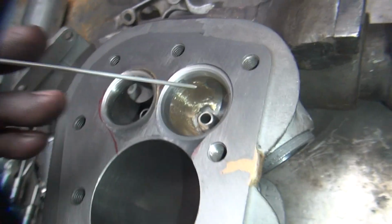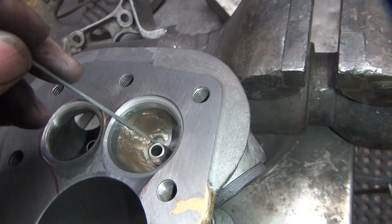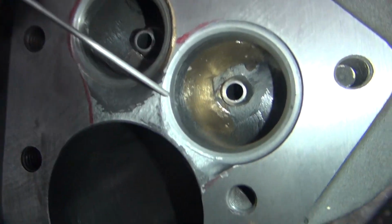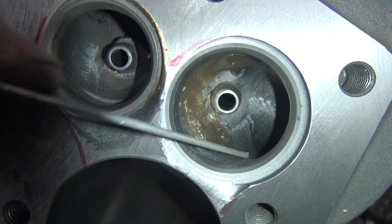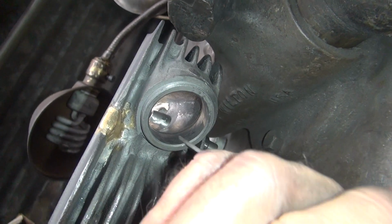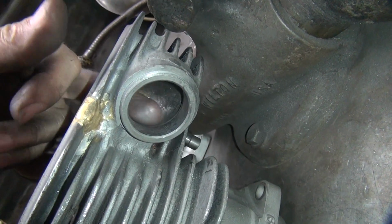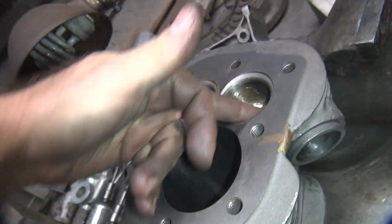The intake port, we did a lot of cutting on that. So the air can come straight through here real nice and easy. There's all this taper stuff in here. We did the brass. And I had to do a lot of cutting all through here. All this stuff here got cut away. There used to be a big hump right through there. So now it just radiuses right on through. So you get a nice flow right around through this edge here like this. Nice even flow. Comes right out the top like this.